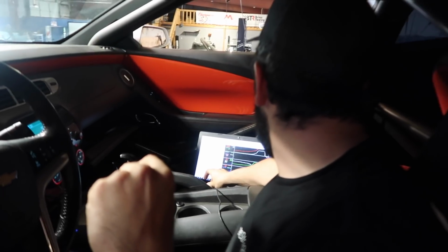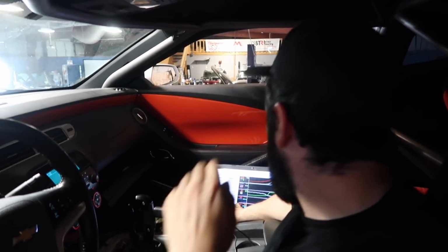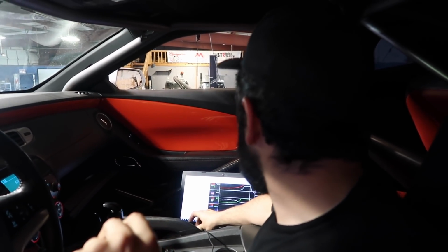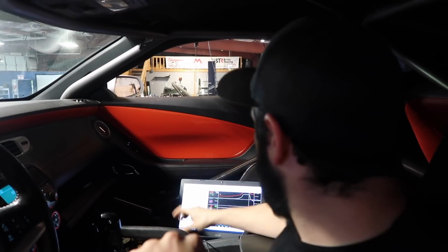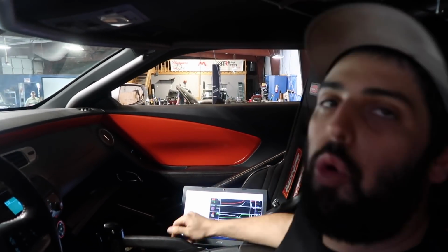Yeah, no, that was good. I had 6,500 RPMs. Is that the same dome pressure? Yeah, that's 10 on the dome. And how much more did it make? It went up 1 kPa. So it made about 20 horsepower more.